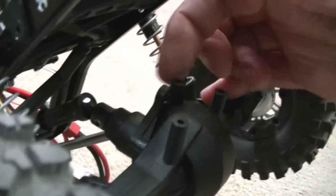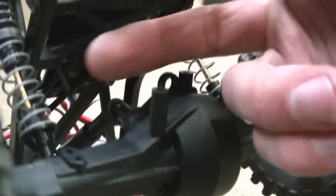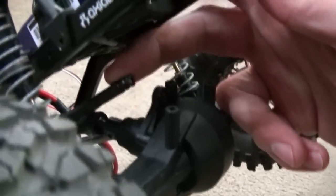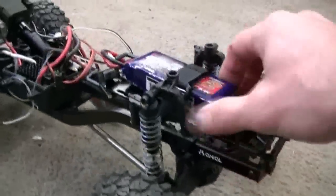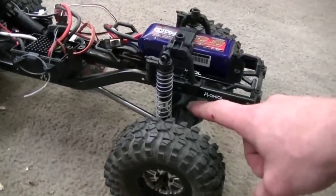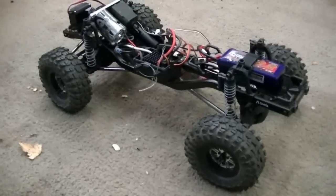Why is that? Because the link is only a single pivot right here. All you need is a little bit of power and the link pops right out. You can see the top link just sitting there wondering why it's not in the right place. We're going to upgrade this to a four-link truss. The GCM truss is a solid piece of billet aluminum that bolts in through the back mount holes on the axle casing, and with a side screw going across there's no way for it to rip out under power. This is why you need solid aluminum upgrades on the back of your differential. At 45 amps in first gear, this truck has no problem ripping the suspension right out under high traction.